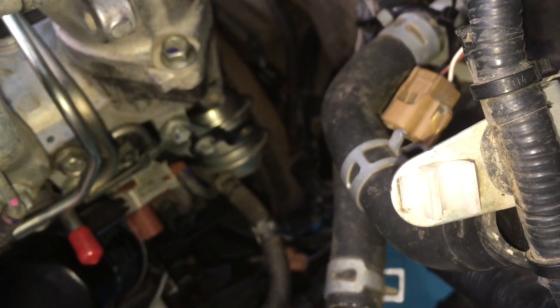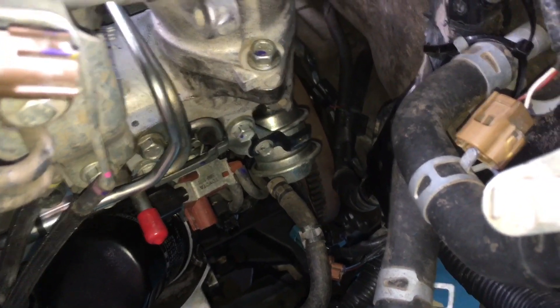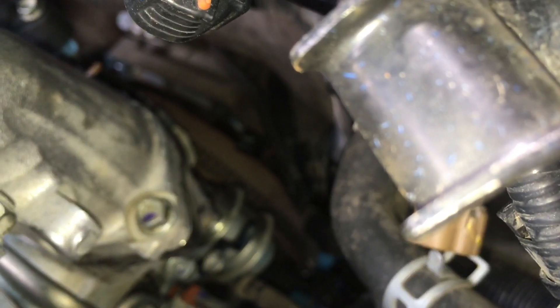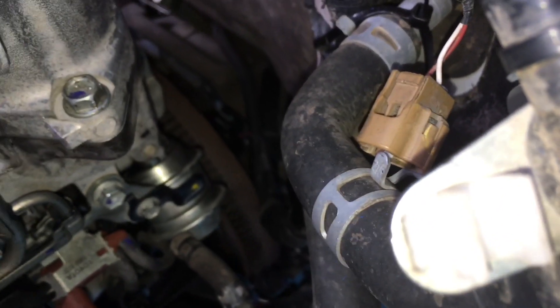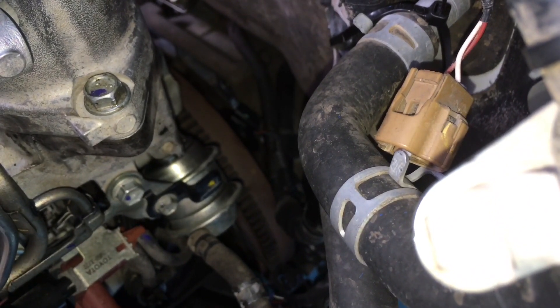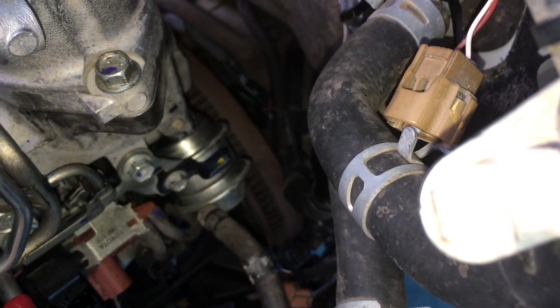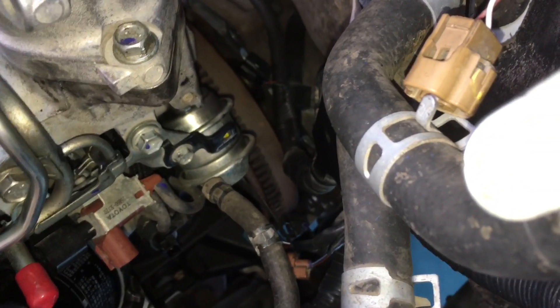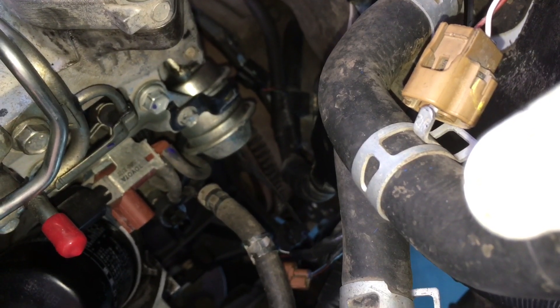From my view down here, to clear the engine mounts and line it up it still needs to go down about 10mm — at least — to get the drive plate in the bell housing. Backwards — but you can't go backwards too far until you go down more because the drive plate is about to hit the bell housing. The bracket for the mounts on the block is sitting on top of the big engine mount bolts — so this side needs to go further back, but to go back it's got to go down first.